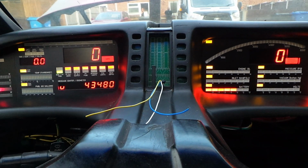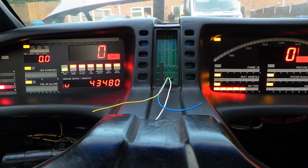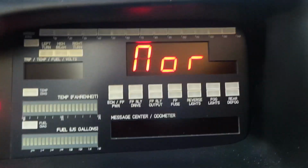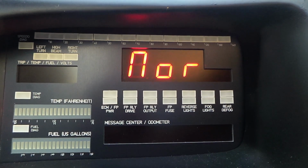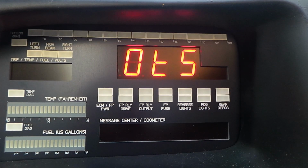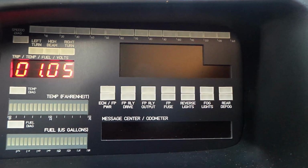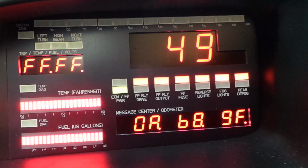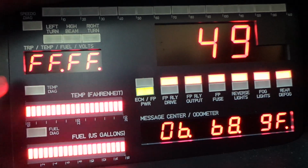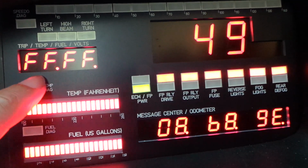Let's just do a quick input test mode on one of these modules. Okay, so DM2 I've put into menu mode, and let's go show mode, output test mode, input test mode, and select it. Now input test mode. This is showing the hexadecimal values, so that's a number from 0 to FF for each of the analog inputs.